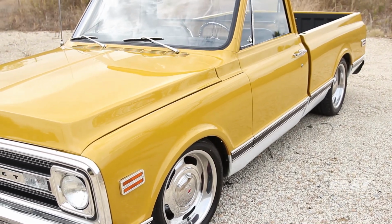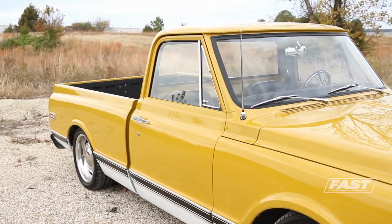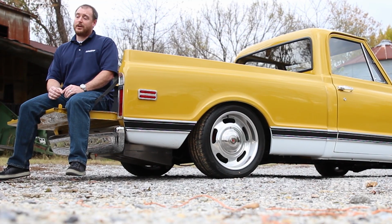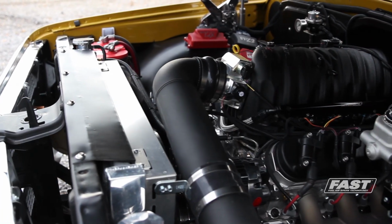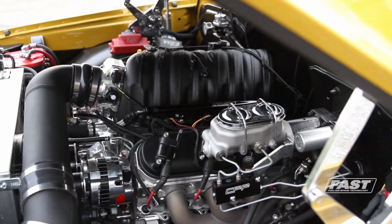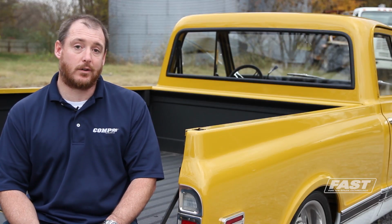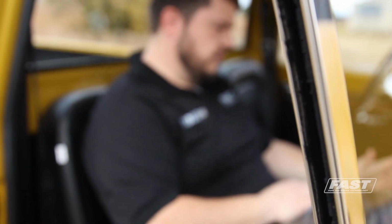They also added their truck arm suspension, which is a full tubular deal, their Ford 9-inch rear end, 12-inch disc brakes on the back, all supplied by CPP. Up front, same deal, tubular cross members, 13-inch big disc brakes. Their engine mount kit operates on a slider system, so you can slide the engine forward or backward to accommodate different pulley systems or whatever you need clearance for. Really trick deal. The transmission cross member bolts right into place using the factory holes. Really slick deal. This thing drives like a go-kart. Really enjoy driving it.